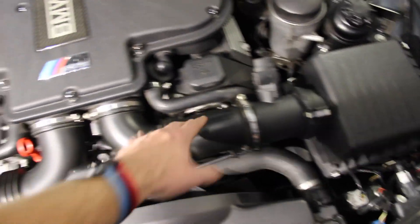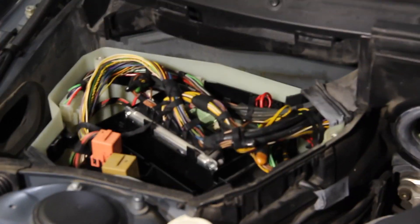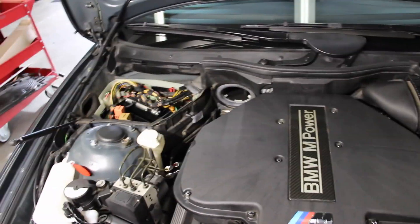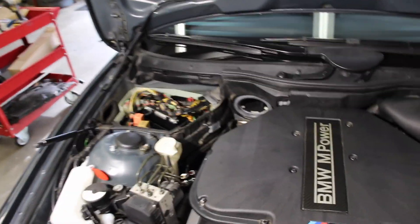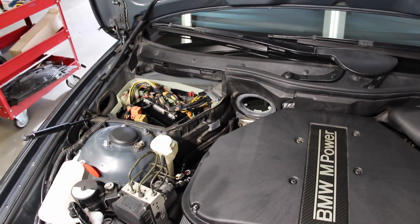We're going to need to remove the intake airbox, the upper and lower intake plenums, and then we'll need DME box or ECU box access to run one pin into one of the electrical harnesses. We actually just finished a DME box fan installation, so I'll include those clips of getting the DME box down to that point here.